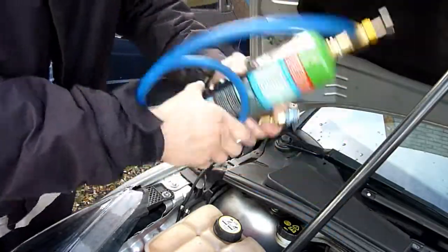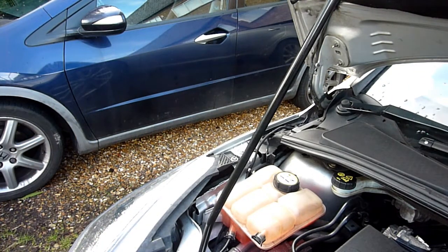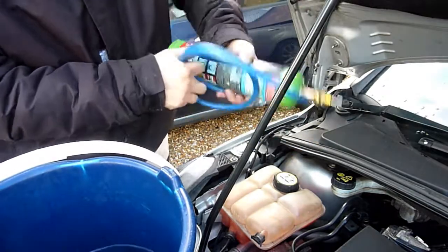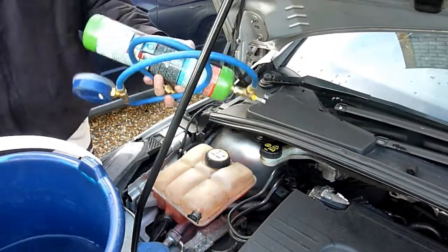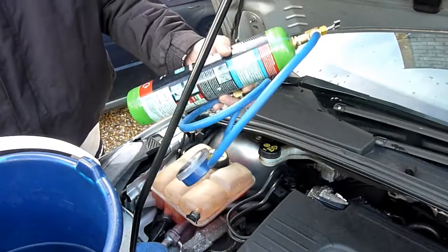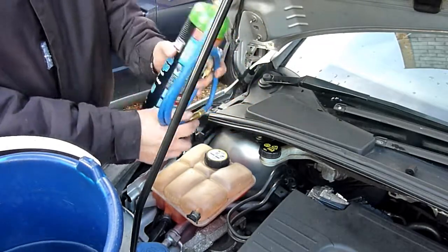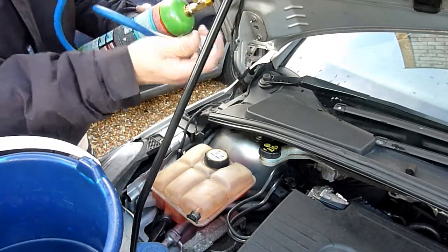Give the bottle a good squish before getting onto that stage. Now the trick — why have I got a bottle of warm, hot water? Because when we add the refrigerant, the bottle is going to cool down as it loses pressure. You'll end up only adding maybe half of what you could have got. Instead of a full charge, you only get half because of the laws of gas dynamics — Boyle's Law. It's P1V1/T1 = P2V2/T2. By that law, when the bottle gets cold it loses pressure. That's why I've got the bottle of warm hot water.